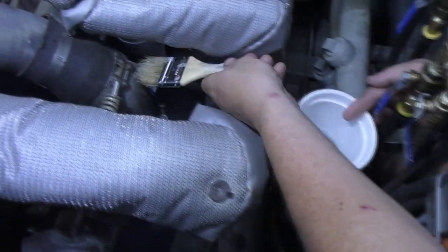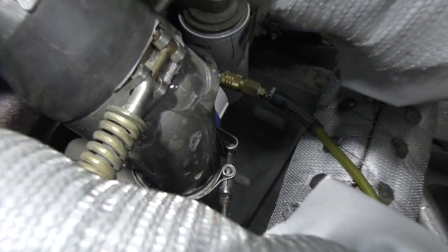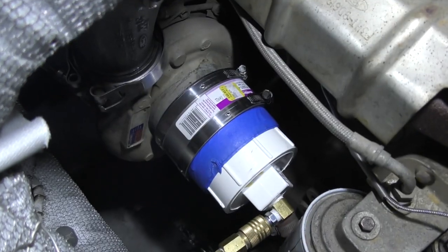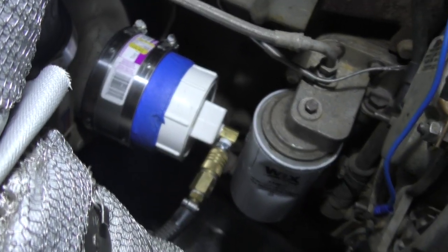But Andy, being the diesel whiz kid he is, says that if this thing leaks, and those soap bubbles mean leaks, then you don't get the pressure that you want. And all he's done is he's got some hardware fittings and he plumbed in an air line to the front of the turbo that normally sucks in the air, and he's blowing air into it and checking for these leaks with soapy bubbles. Simple thing. Good fix. And yeah, that's just sewage parts, with an air chuck fit into the back of it.